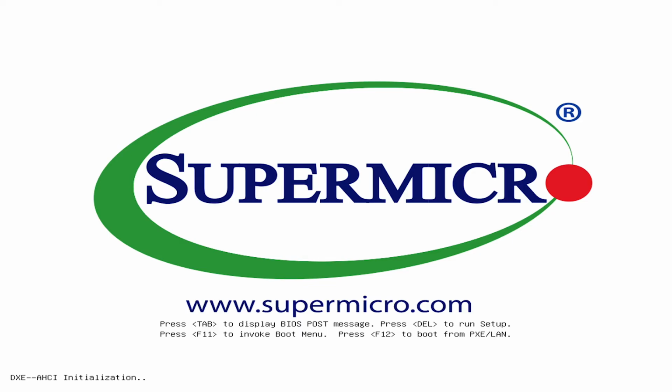That means everything booted and everything's good, but that doesn't mean the system's 100% stable. We'll test that with Cinebench R15 and Cinebench R20 runs. First, Cinebench R15, which is non-AVX, then Cinebench R20, which hits the CPU much harder, and we'll see exactly how stable this is and if it runs well.